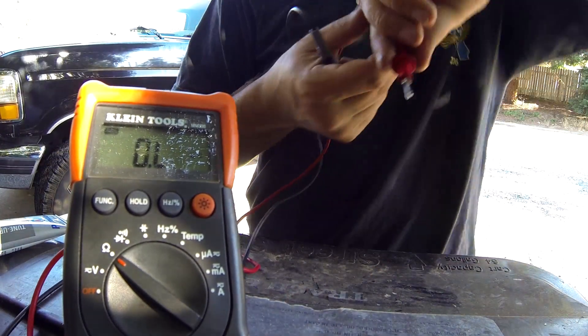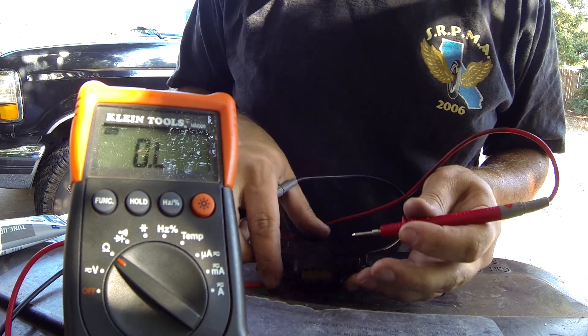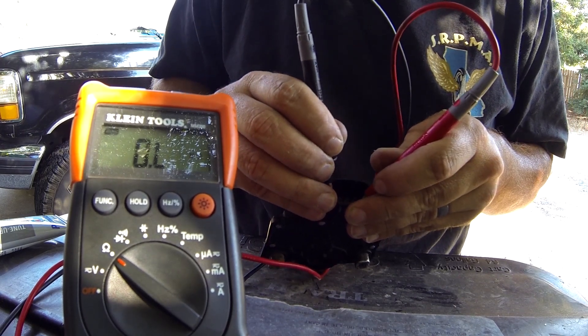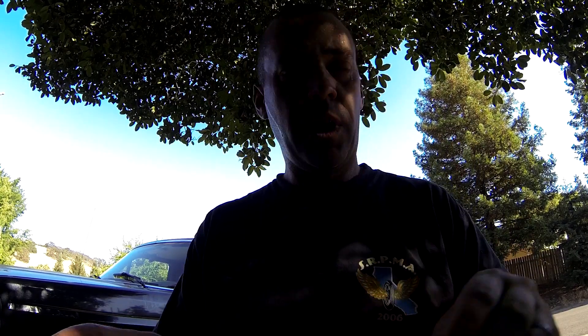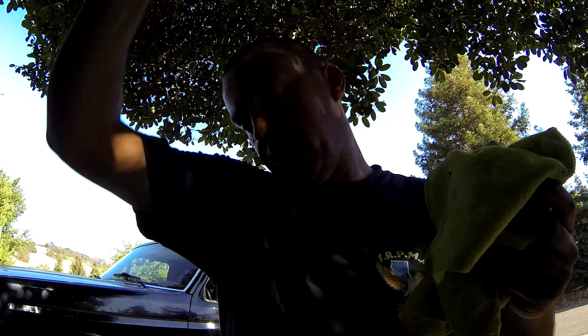And there it is — open. Now when I take the old one, what I'm hoping is the bad one, same pins, metal side, first and last: I get open. I don't have a closed system. On the non-metal side, I get continuity — all zeros. So I'm thinking I have a short in here somewhere. When it goes into limp mode, if I turn the truck all the way off and start back up, it goes away. So it's obviously an electrical problem of some sort, and it will either come back right away or sometimes not at all.